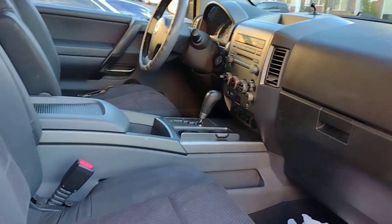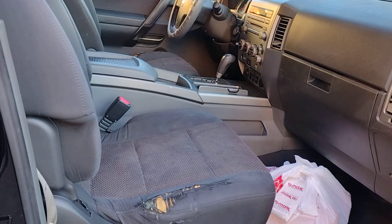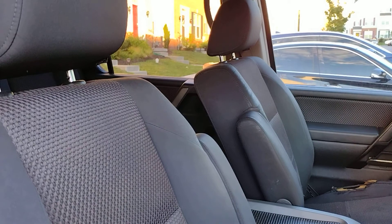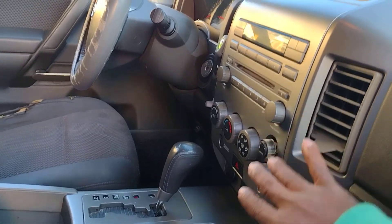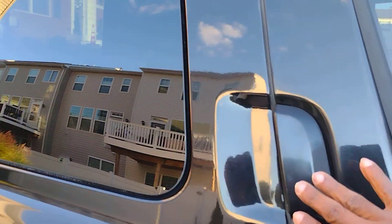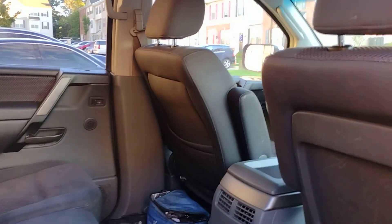Let me walk you through the interior - it's not in the best shape, but for the age I guess it's okay. I'm going to try to save and repair the seats - this is the passenger side - and the driver's side as well, which is not in the best shape. At worst, I'll clean the seats and interior and put seat covers over them to hold things in place. I'll also need to replace the rear HVAC knob which controls the heat flow in the rear. I've charged the AC, so the AC actually works, and the heat works too. The blend door actuator is a little funny but still works.